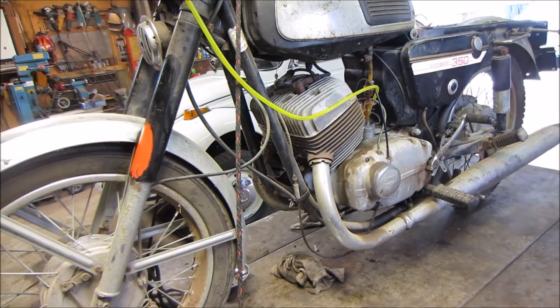Where we're going is: the headlight does work, but as you can see, the brightness is ridiculously nil. One of three things is going on: either we just have a very poor ground, that's a 12-volt bulb with a 6-volt battery, or the bike is supposed to be 12 volts and there's a 6-volt battery in the bike. Let's go figure that out. I looked — the flasher says 6 volts on it, and that bulb says 6V 35/35 — so that bulb is a 6-volt bulb too. What we could do is take the jumper pack or battery charger and put 6 volts directly to it and see how bright it gets.